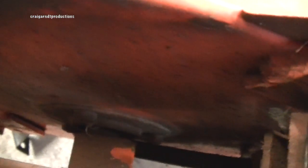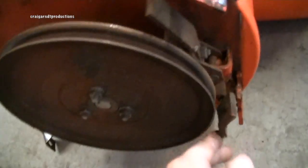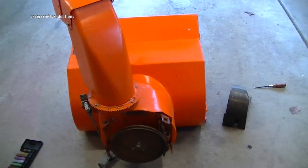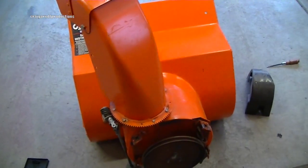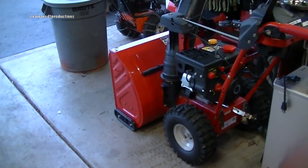So what we're gonna do is take off these, pull off this giant pulley, and replace the brake lever — the brake looks a little used up where it's all worn. We'll get that straightened out. Oh, and I broke this clip — this one works and this one broke, so we're gonna order one of those. New belts are on the way as well as a new spring. This is the third part which I thought would be a conclusion — next will be the fourth part. But hey, when we get done we will have a fantastic running snowblower that will out-compete this MTD piece of junk.